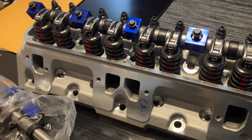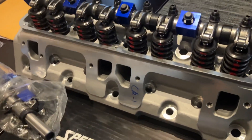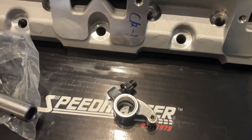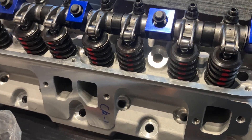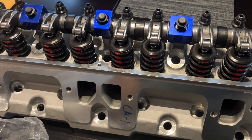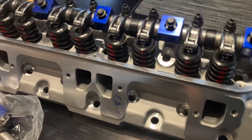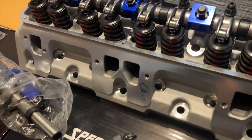I still hang on to hope for that, but the truth is even some of the big names out there in testing haven't proven that good. The other reason I put off buying these — I like the design of the rocker, sort of. They're stainless, and that sounds great for longevity, but that also adds weight and mass. As you get up into the higher RPM range on your engine, that could lead to valve float if you don't have a stiff enough spring to control the mass of these stainless rockers. That part I don't care for, and I stayed away from them.